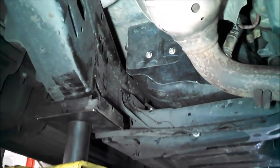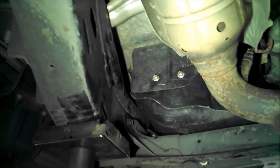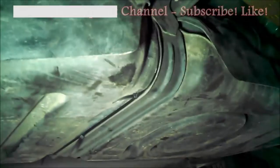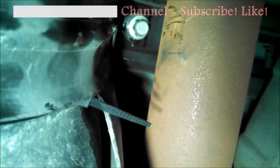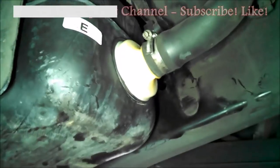For a 2005 Ford Explorer gas tank removal and fuel pump removal, it's right up here on the passenger side — a 15 millimeter bolt there, and a 15 millimeter bolt up there. Kind of a tight fit, but I was able to get it with a swivel and a short socket. That one I think was a 7 millimeter or a screwdriver to take that off.